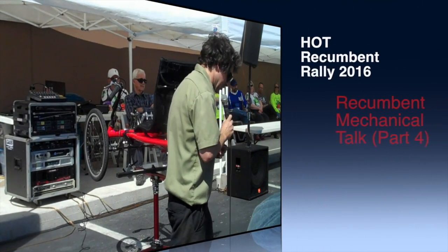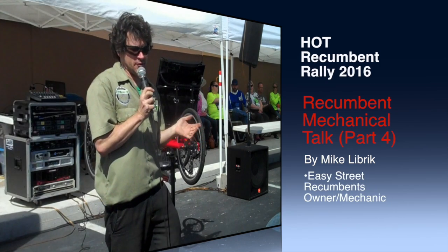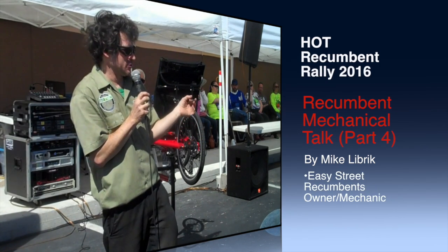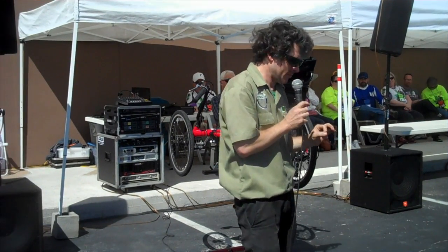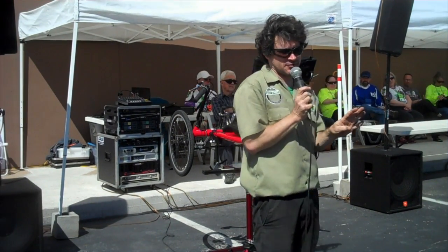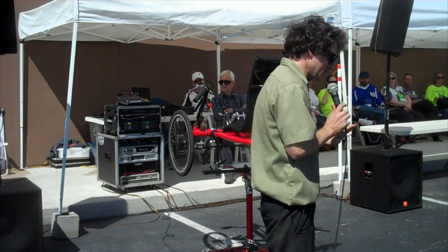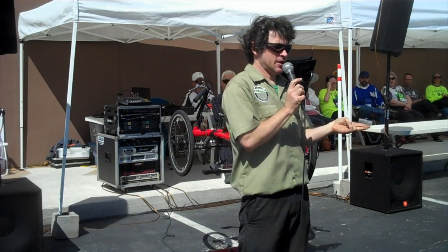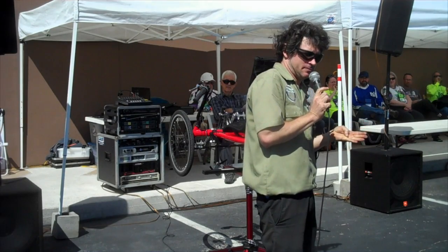Okay, so derailleurs and a little bit on disc brakes. Rear derailleurs are much more standard. There are SRAM rear derailleurs and Shimano rear derailleurs, which are a little different in ways, but they all basically work the same. And there are 4 things that can go out of whack on rear derailleurs. These 4 things are the derailleur alignment, the cable tension, the limit screws, and the gap.